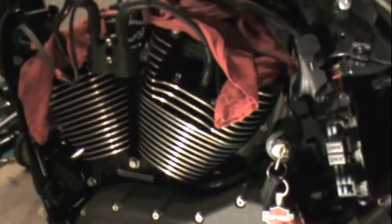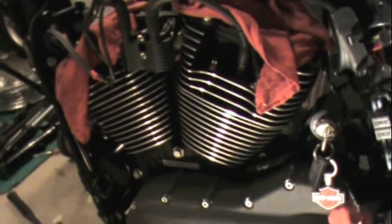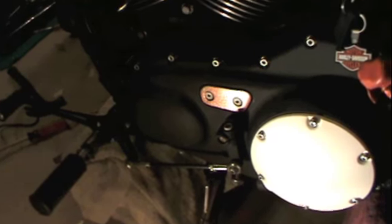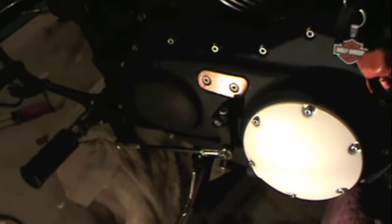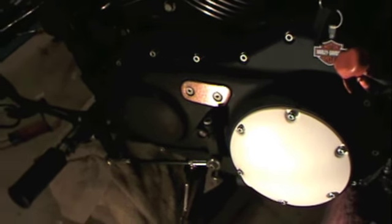That's pretty much it in terms of powder coating. It's not a hard process, not a hard thing to do. You have to take your time, and I think most of your work is in preparing the piece to be powder coated. Prep work is, I think, 2/3 of any finished job. It's no different with powder coat. You have to get it blasted down to the metal, clean it up, preheat it, clean it up again, and then you're ready to powder coat it. But if you don't do that, you're going to have some issues, and I can attest to that firsthand.